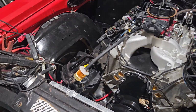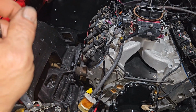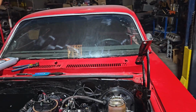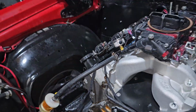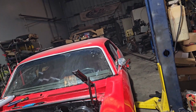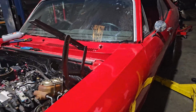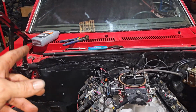And then this morning I came in and routed the fuel line back up, mounted the electric pump. I did a compression AN on the aluminum line that I had put on, all that new aluminum fuel line. So I did a compression line with a piece of rubber to the pump and then a piece of rubber to the pickup on the tank. And then I got all that sorted out.